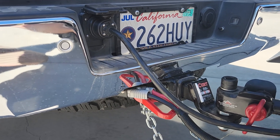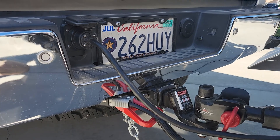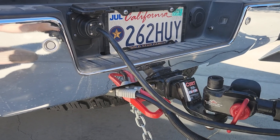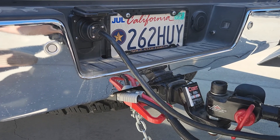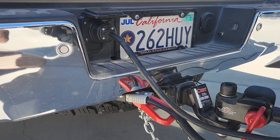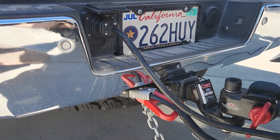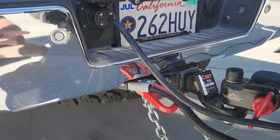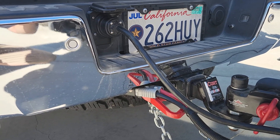What's nice about this is on long trips my batteries are fully topped off at all times. It goes from the start battery through the disconnect back to the BC/DC controller, putting in 25 amps constantly. When we get to camp after an eight or nine hour drive the batteries are good to go. On our last trip we didn't have much sun and I forgot my solar panels, so I ran the truck for about 30 minutes after three days — so much easier, because I can charge the batteries right through this connector.